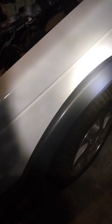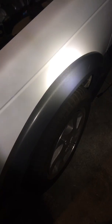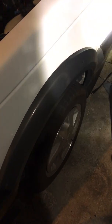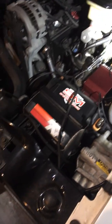Suspension-wise, I don't know. It rides pretty soft. It rides pretty comfortable. It's still on the torsion rods, factory leaf springs. It just got Bilsteins all around, and it does have a rear sway bar now. The airbag control, air shocks and all that, they're gone. So it does ride nice. It's a little soft, it's whatever, but the Bilsteins did stiffen it up a little bit, and that rear sway bar worked. I kind of like the way it rides.